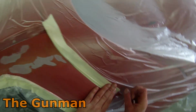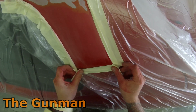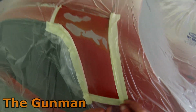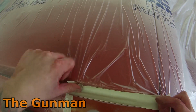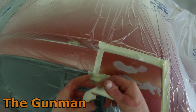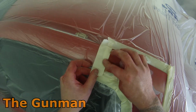That section that runs around the rear windscreen, that's coming off. These 2 quarter trims are coming off. Also the hard lid's coming off as well. We've got to pull 1 or 2 of the door handles out, but that'll be done later on too. That's not anything to worry about at the moment. It's just that masking, as I said there, bit of hard edge masking there, that's fine. And I got a little bit of rope underneath those quarter glasses too, just to lift that rubber up to stop us from getting a big thick edge.